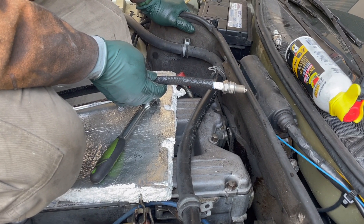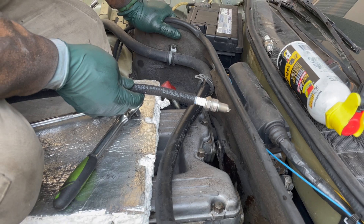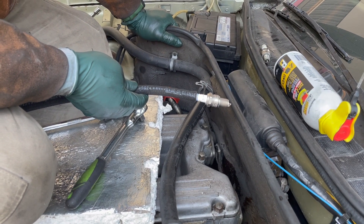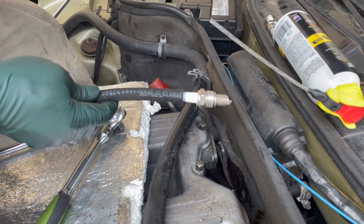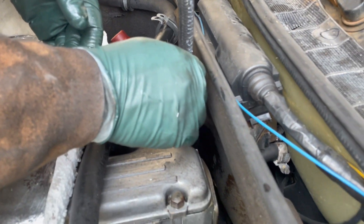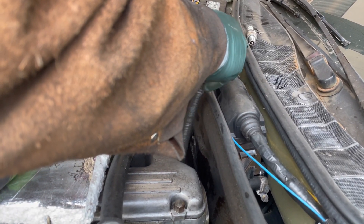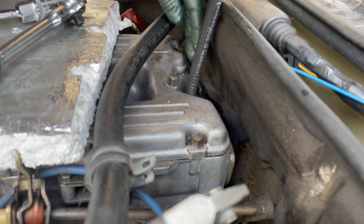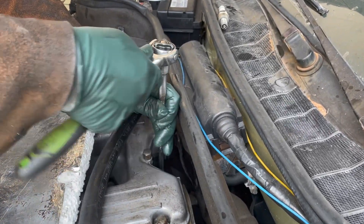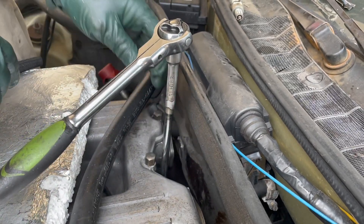The threads are chased, and now we're going to install a new plug and see how it feels. Notice I'm using a braided hose — I always recommend installing spark plugs in these old aluminum head engines with a braided hose. Start it by hand before you ever put a wrench on it, and that's probably what got the person in trouble here. With that hose you can literally feel it go in, and then you're turning it all the way in by hand. If it doesn't go in by hand with the hose, then you've got a problem. Notice the hand is close to the head — you're not going to over-tighten it. You're going to feel it seat out on that head.